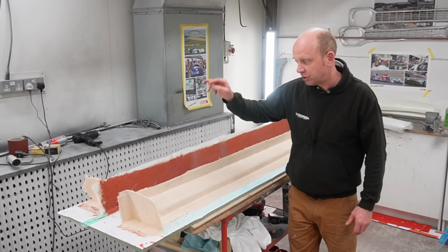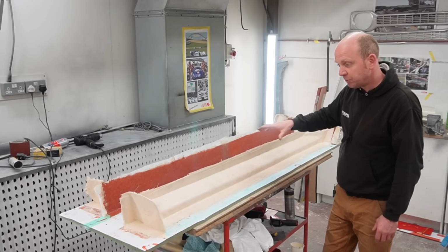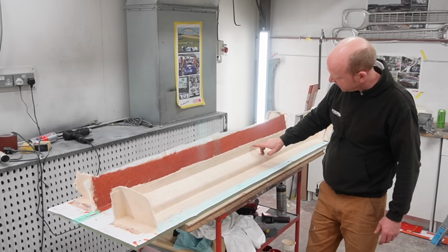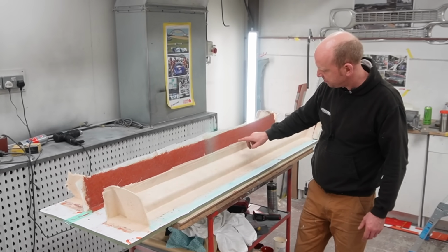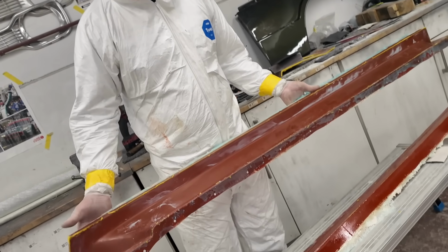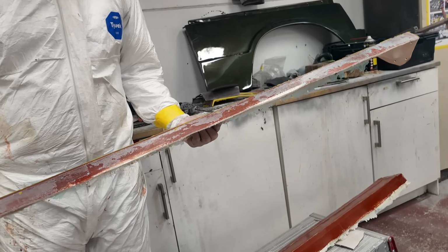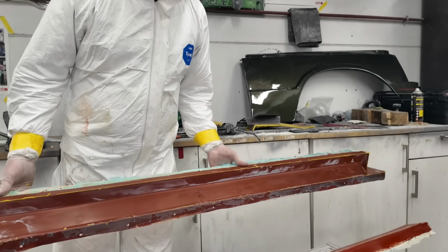Then I've literally just got to do the 2 ends on that part, and we'll have the 2 moulds. At that point it's a case of drill all these flanges, bolt them together, trim these flanges back to a sensible distance outside of the bolts, obviously, and trim all this rubbish hanging off here, that will all be cut off. Then undo all the bolts, break it apart, and I should have a mould. Inspect it and hopefully not cry horrible tears of finding lots of things wrong with my mould. It should be fine though, I'm reasonably confident.